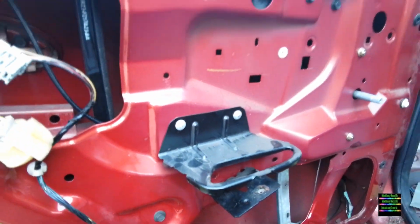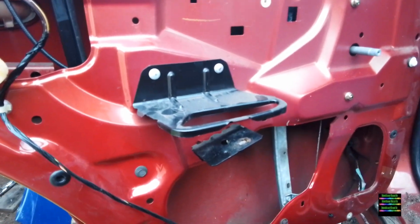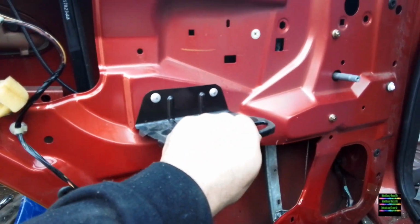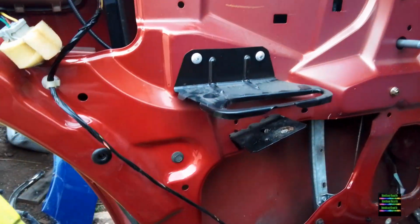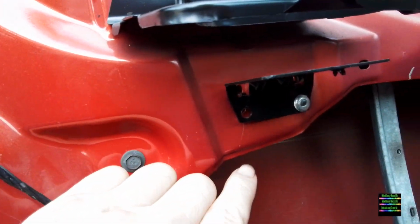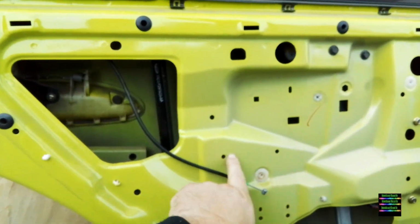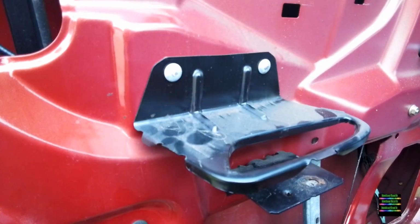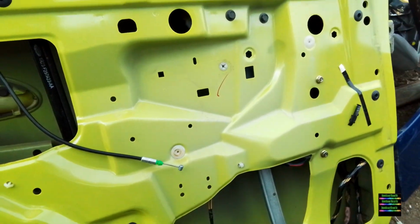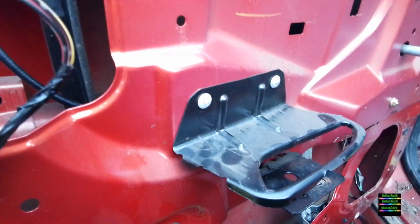Okay, so this is the door we're taking apart on this BF Ford, what makes it manual operating at the back. So this is where you normally would pull the door open and close. So these two are going to be cut off, and there's one already I noticed broken on here, so that's going to have to come off, because this is the one, and this is where the 2 holes are. Those 2 and these is where that smaller part is, where it screws onto with the door trim. So I'm going to get the angle grinder and trim them off, trim that single one off, and we'll go from there.